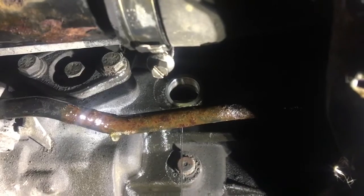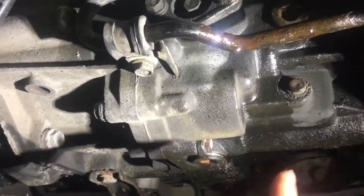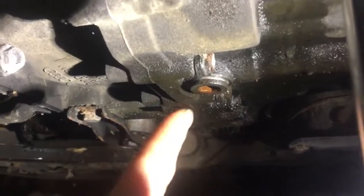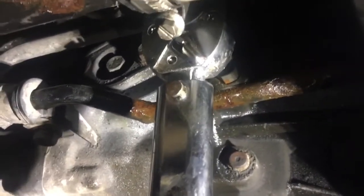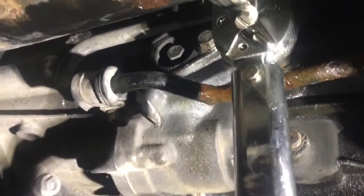That's now filled to level — just letting the excess drain off before putting in the bung. The total amount of oil used was about 2.6 litres. I have the bung and fill plug done and we're going to torque them to 30 newton-metres. That's the gearbox now finished.